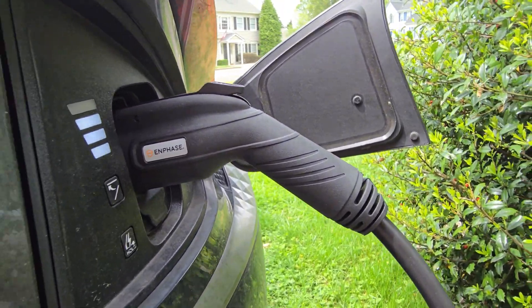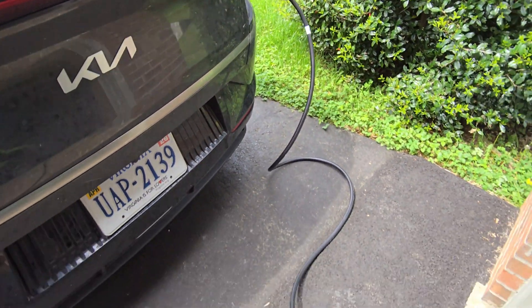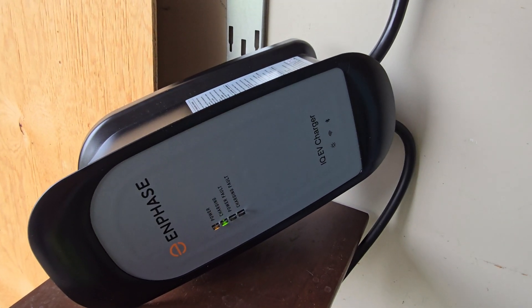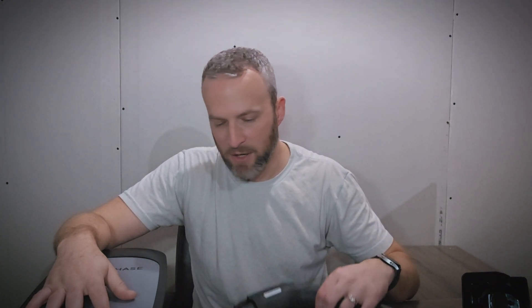When it comes to charging with my EV6, I charged it for a few hours and it charged great. I did not check temperatures, being that it's only a 32 amp unit — I knew I wouldn't have any issues there. I have never had any issues with 32 amps from any charger. It's usually when I get up into the high 30s or 40 amps that I would see any kind of charging throttling or heat issues. The connector is one of my favorite parts because it is very rugged. Tom, on the State of Charge channel, dropped it from high heights — around six feet — and it stayed working great after that. It might have gotten a little scuffed up, but it still worked fine, and it's designed to handle that with its ruggedized finish.